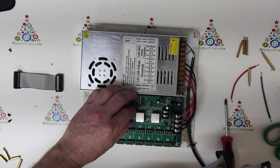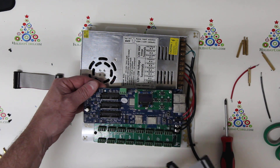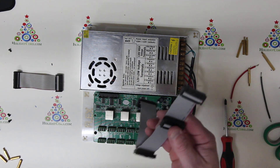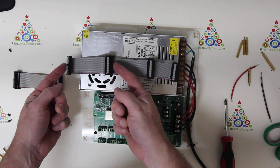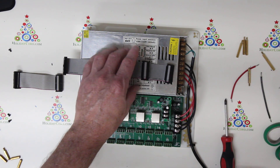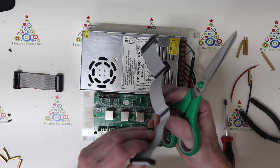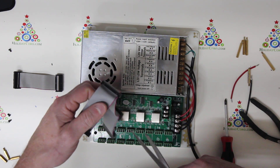When we stack these boards, we're going to stack the long range here, then put additional spacers and then the CPU on top. This cable length needs to connect all the way to the bottom. We're going to cut it so that it's on the longer of the two. We could cut it here and end up with a shorter section, or here and end up with the longer section — so we're going to cut it longer.